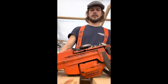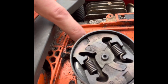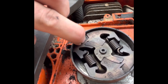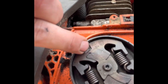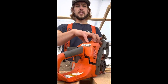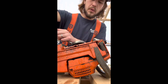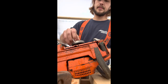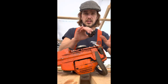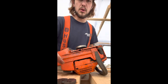The next step is to get this clutch off — super simple. You can use the specialty tool, but they've put little ridges here and it even says the direction to turn it. Some people like to remove the spark plug and jam a rope down in there to lock the piston, but I do it the traditional way. This is where I suggest you lay stuff down left to right in order you took it off, so you know it goes back together right.